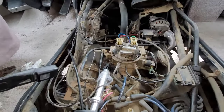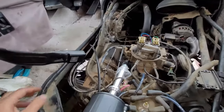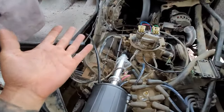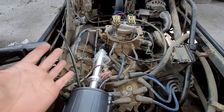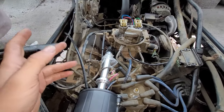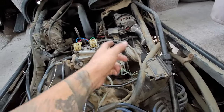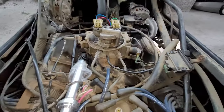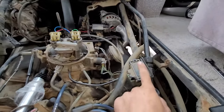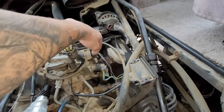If this video helped you out, give it a thumbs up. A guy commented on the other video saying he didn't get anything, so I wanted to make this video to show that. Now, if you're getting all that and the car still isn't starting, check your idle air control valve, your mass airflow sensor, and your MAP sensor. Make sure you're getting voltage at the MAP sensor, idle air control valve, and throttle position sensor.